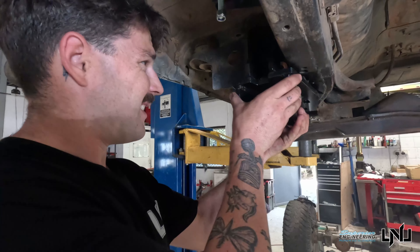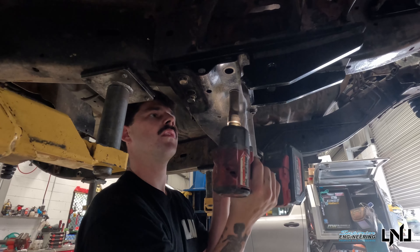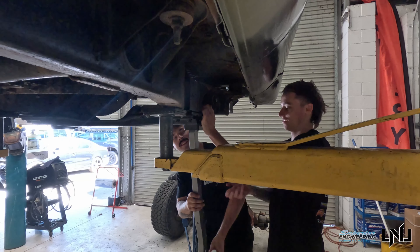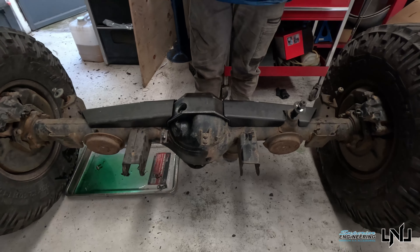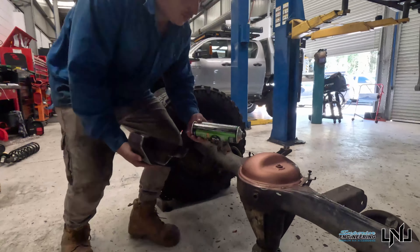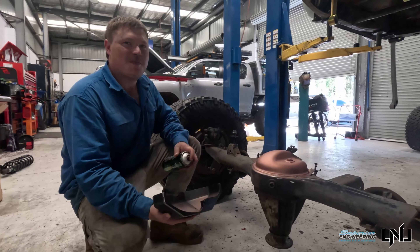While he's prepped, I'm going to chuck these drop boxes in and get the front arms ready for the front diff going back in. We're spraying copper weld-through primer on the back side of the diff where we've removed all the paint — it's all bare steel. By the time you weld it, it's basically heat resistant and prevents rust.